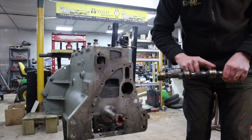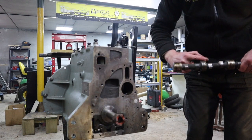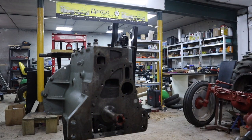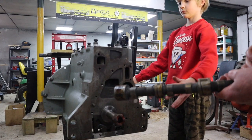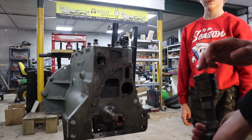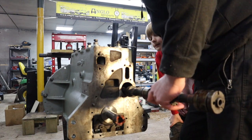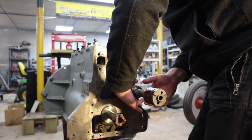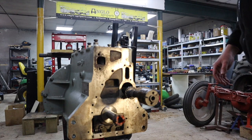When you're putting this in — I remember when we were taking it out — it's quite a jiggle getting it in because you have to go through all four of these bearing faces. We obviously check which way this goes: the gear needs to be in line with the distributor, which is essentially at the front of the engine. We know this has to go in this way. You just kind of work it through and turn it slightly as you go.